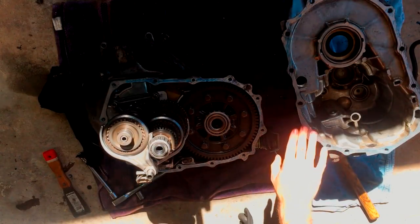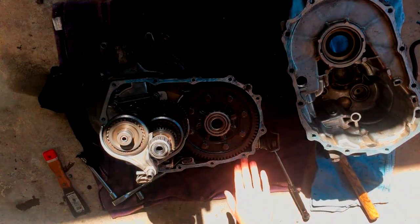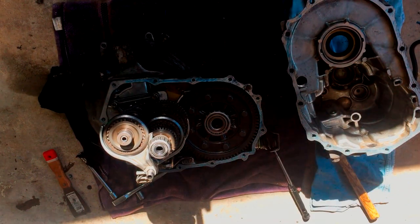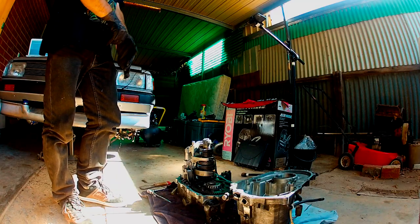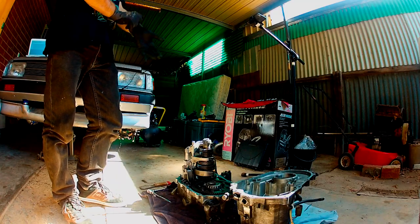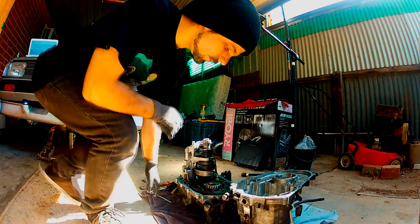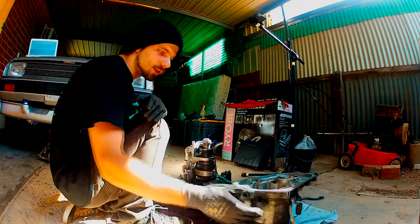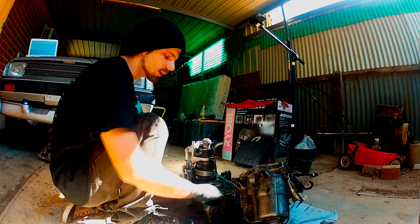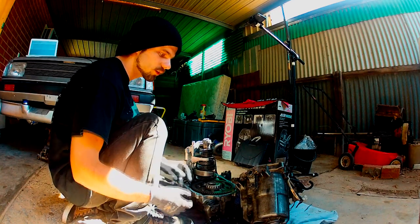I've cleaned up all of the metal faces on the bell housing and the rest of the box. What we're going to do now is put the bell housing on, but first go through all the gears and make sure you can select every gear. You don't want to put your gearbox in and then discover you've got no reverse or no first gear. Check it now rather than later, and also before you put any gasket glue on - because you don't want to have to pull it off and re-clean everything.